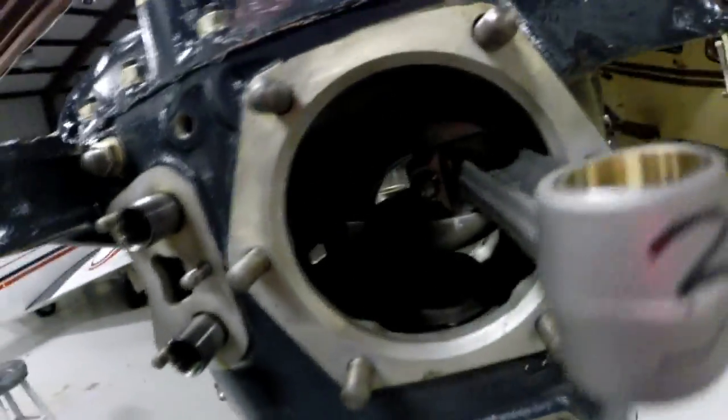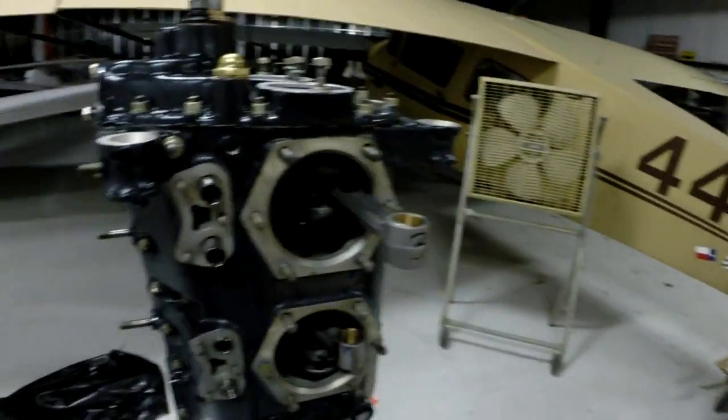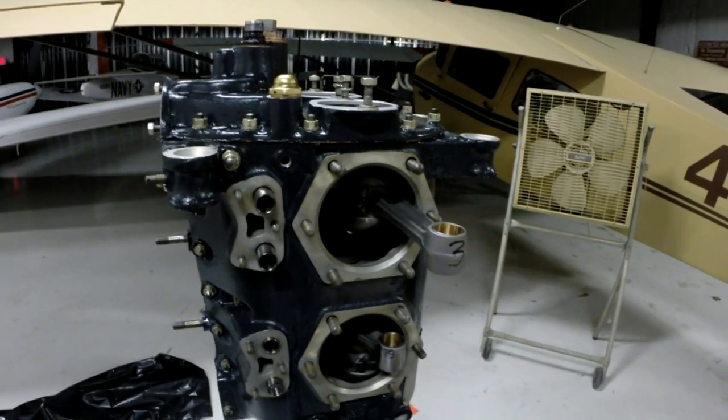I don't have much light around here, but if you can see the camshaft in there and those lobes on there, you can see these little shiny bodies that are moving back and forth — rising up and down on the lobes of the camshaft. What that does is coordinate your valve opening and closing. Your valves are on the engine on the cylinder head, and that opens and closes sucking in and discharging exhaust gases.